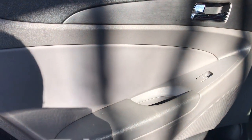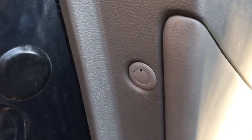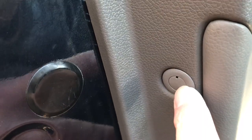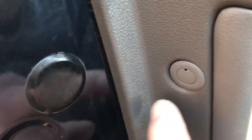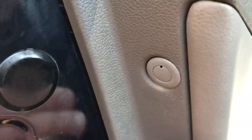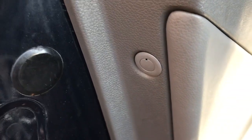So I'm taking out this door panel because I need to replace the door lock actuator. How does it come out? These little plastic covers are very small — you need a metal pick. Just a note to remember: if you notice the little access port is at the top, when you put it back in, put it back at the top so it looks factory. If it's off to the side, somebody's going to know the door panel's been removed. So you need to pull this one out — I just use a plastic pick. Get in there and pull that out, be gentle. It is plastic.